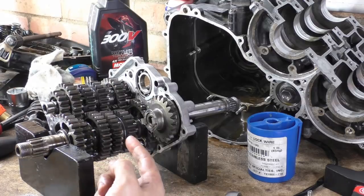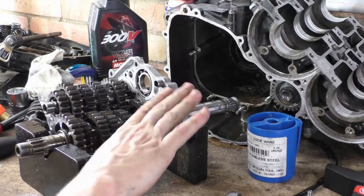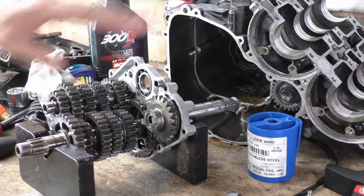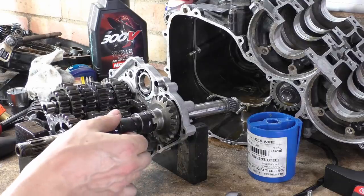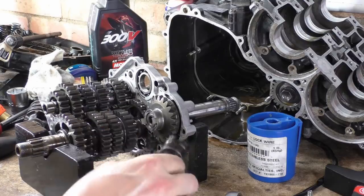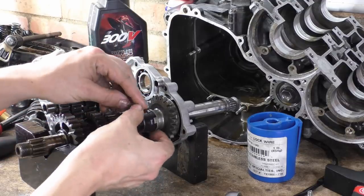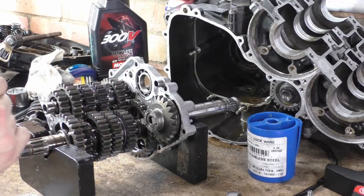If this was straight through metal, if it goes, because you're putting so much torque onto it and it bends out, it's going to wreck your casings, and then it's new casings, which in this case is the entire bottom end, which isn't cheap. So this is them saving you from breaking and shattering your stuff. That's just got basically a ring clip, it just goes on there, and that's how it's loosely bound. It's all it is, just this ring clip, which is a bit of a beast.